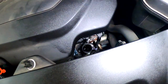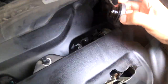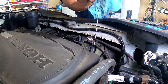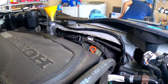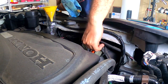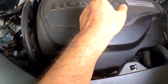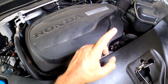Let's put the cap back and set it to an even position to check the oil level and see how much more I need to add. All right guys, the oil change is done — everything is closed. Remember to verify the drain plug is tight and the oil filter is tight. It took 5.5 quarts of oil total.